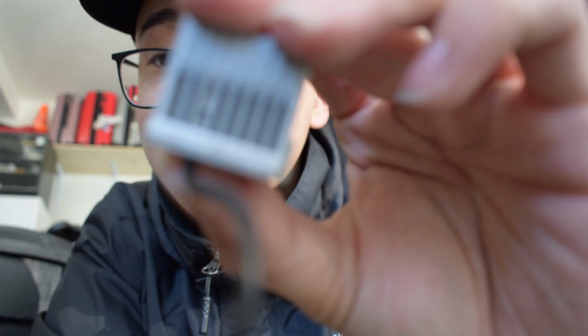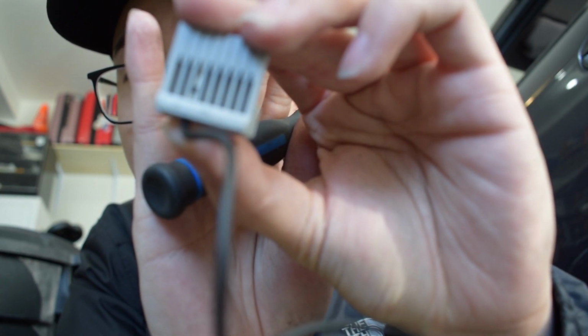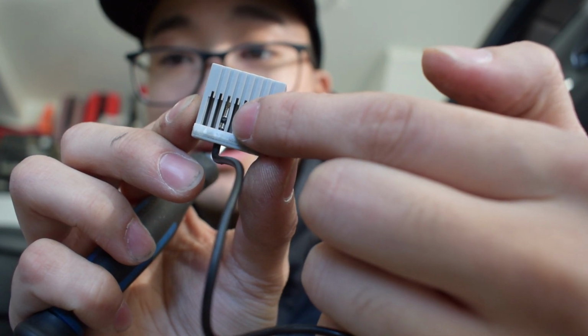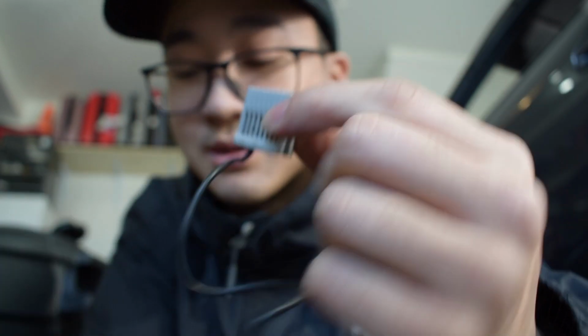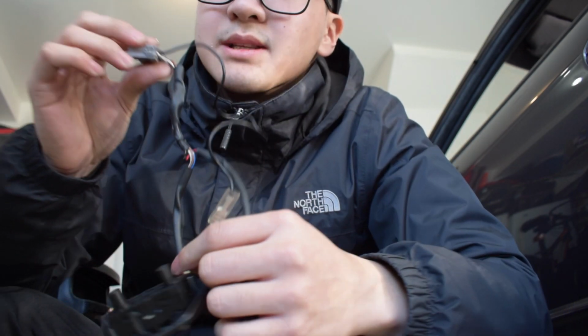At this point, you can see all of your pins, or in this case, one pin. Let me see if I can get that to focus for you there. There you go, that one pin. Near the top here, there is a metal piece that presses against the actual plug, and you want to press that metal piece down and then pull, and you can take that pin out. So let's see if I can do this here in one try. Alright guys, so I have everything transferred over. I have the horn ground wire as well as the rest of my cruise control here and steering wheel controls.